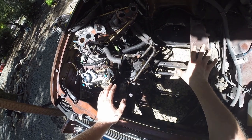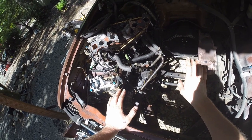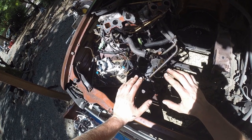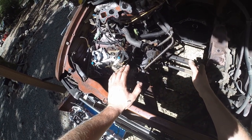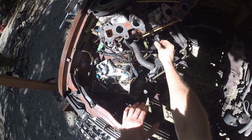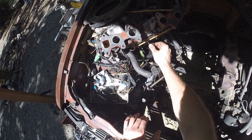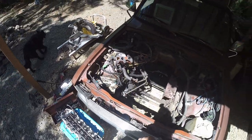I'm probably going to keep the same EGR air pipe but snip it right off the head and crimp it down in the vise rather than build block-off plates and grind down the nipples. I did order an EGR block-off plate kit, so it won't be running EGR. I haven't fully decided between the Weber carb or just running this carburetor with significantly fewer vacuum lines — just the bare minimum like secondaries and the distributor — and blocking everything else off with vacuum caps from Amazon or plugs from the hardware store.